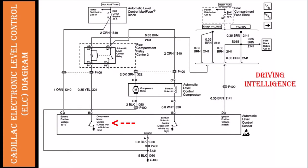When people get out of the vehicle or you take a big load out of the trunk and the vehicle rises, connection E — which is also typically open — will close when the vehicle is too high. That completes the circuit for the exhaust solenoid, which opens up and allows air to escape the shocks. Similar to connection B, point E stays closed until the vehicle reduces down to the predetermined ride height, then opens and turns off the exhaust. This diagram is excellent for reference if you have a Cadillac with an automatic level control system — snapshot it with your phone or take a print screen.